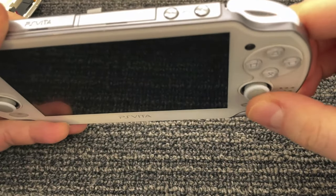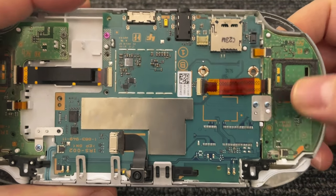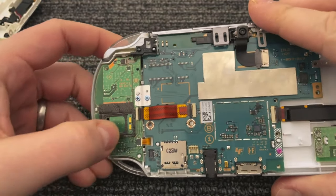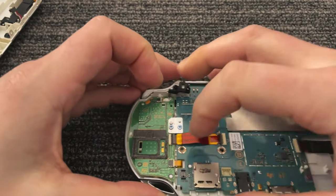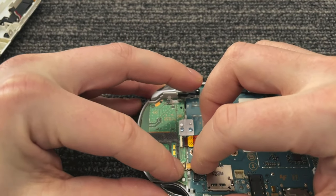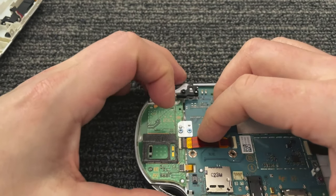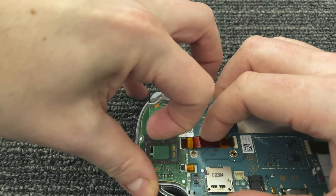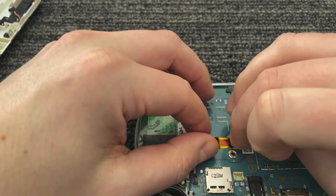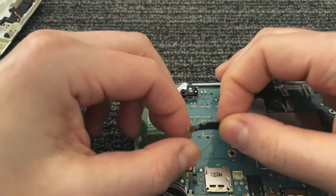When you have it flipped over, you just want to make sure that you're looking at the right side. Yep, this is the right analog stick. I'll want to take a look at the ribbons that are connecting — there's one that connects the whole panel, one that connects the analog stick, and one at the top that connects the shoulder button. Pop those off very gently; they have these little plastic latches that help the ribbon stay in place, and then you can slide it out without putting any real pressure on it once the plastic is lifted up. It just pops out like that — now I can slide that right out.